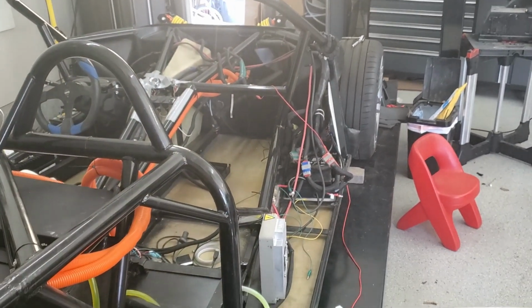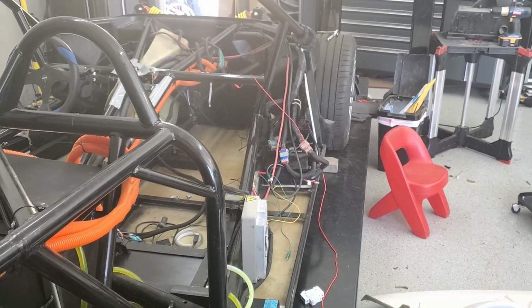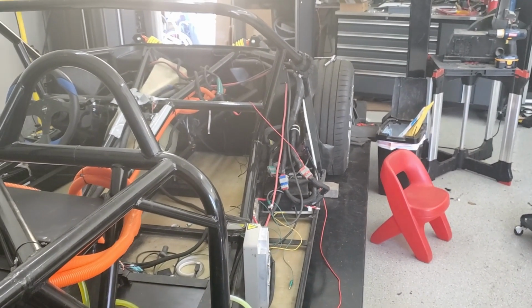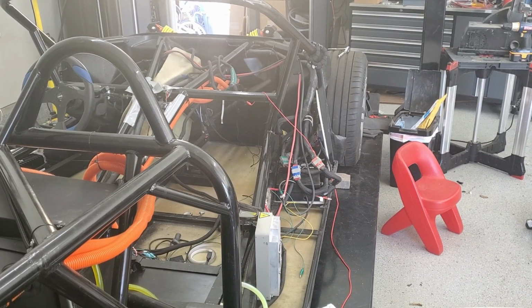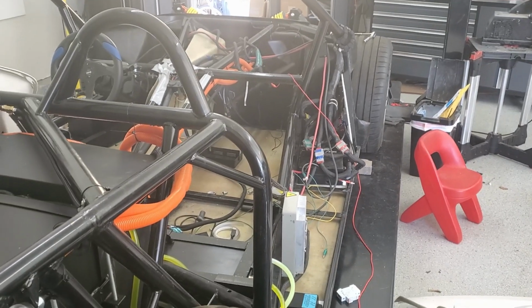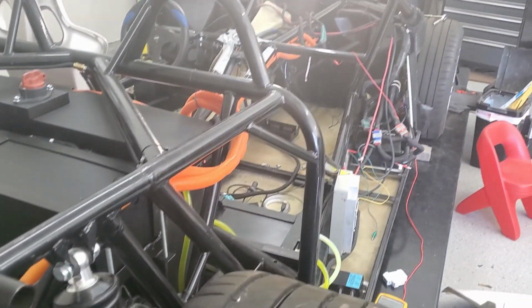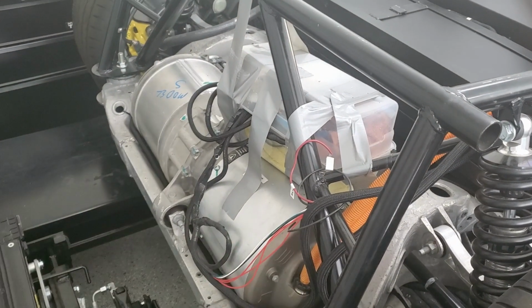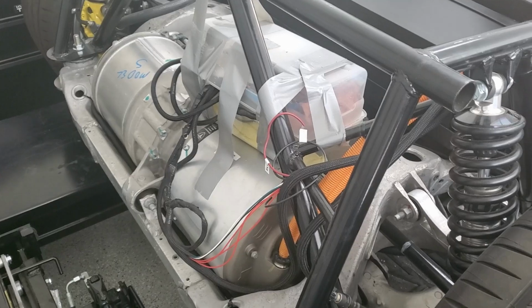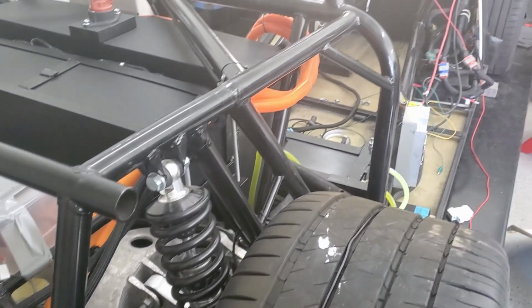So again, the gold plated connectors, new CAN wire way far away from everything, and at that point I think that gives it the best possibility of working. Assuming that it's some sort of a wiring or impedance or connection problem. Knowing my luck, it's that inverter. Something there's fried, but we'll see. EV West says they're pretty robust. They haven't had any problems with it, but I don't know. I seem to have a knack for things.